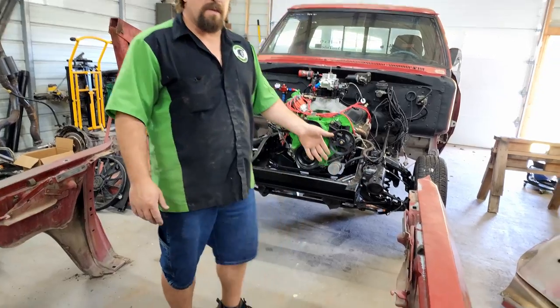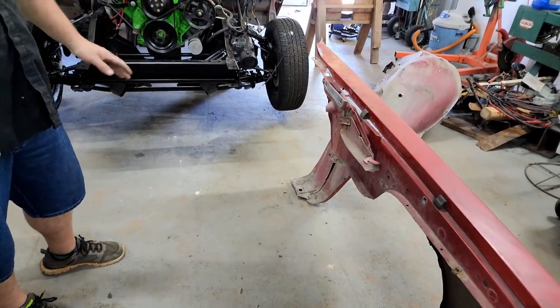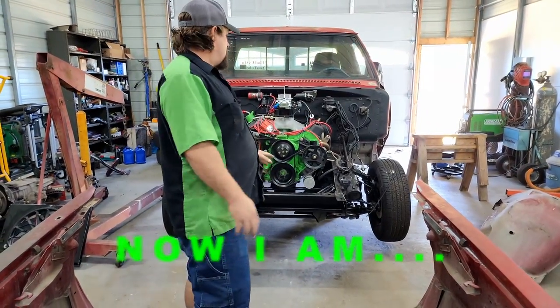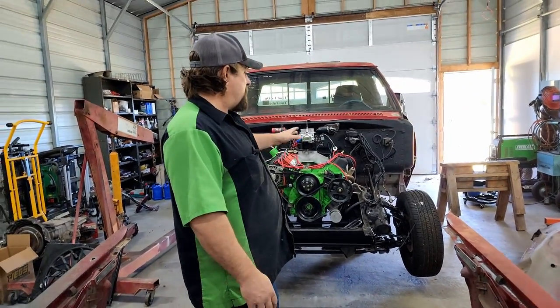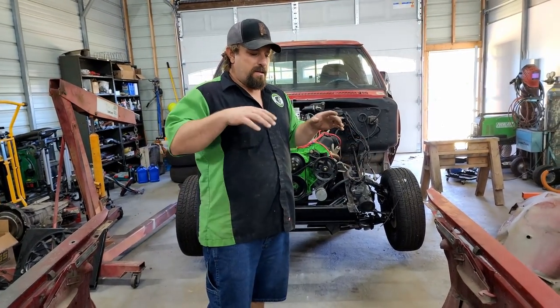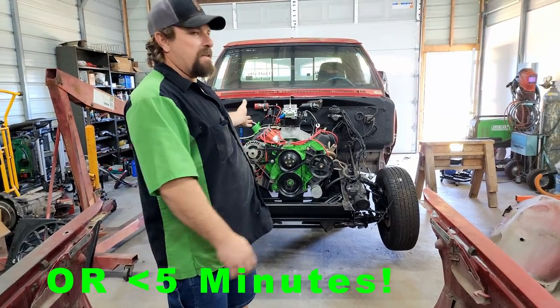There's two bolts in the bottom, but they're pretty easy to get to. And I'm not thinking like easy lift off every time we bring it in from a pass to work on it in the pits. I'm thinking about, we've got to adjust the valves, or we've got to do some type of major maintenance. Quickly, in less than 30 minutes, pull the front wrap off and have it in this configuration to work on it.